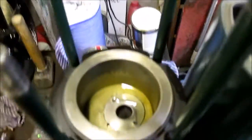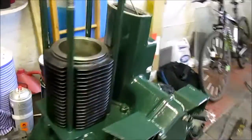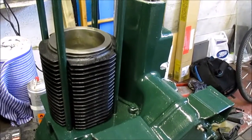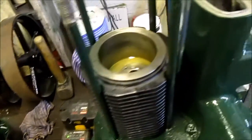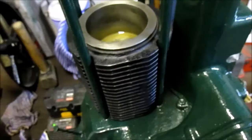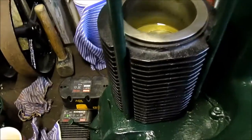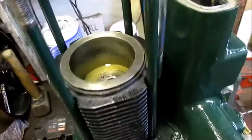I'll put some oil in there so it can soak down around the rings. Ideally if the rings are good it shouldn't soak down, but they'll bed in and find home eventually after some hard work. The next job will be to put something over the top to stop dirt going in. The oil will be key for the first startup because the rings may not be perfect yet - the oil will act as a temporary seal and the first run should bed the rings in enough to give good compression.